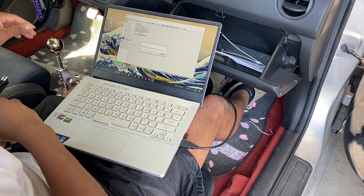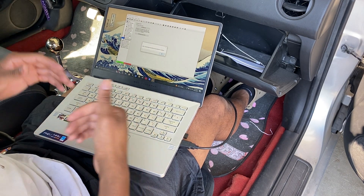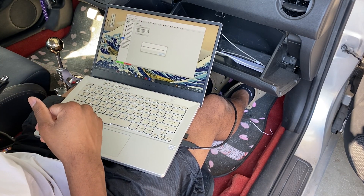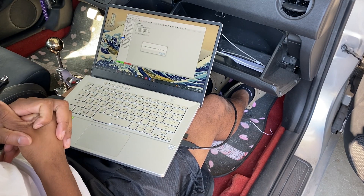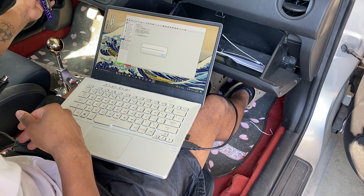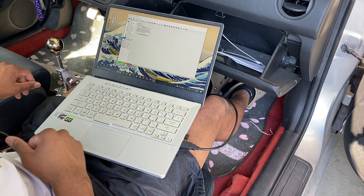The reflash has been done. Go ahead and key off and hit OK. After five seconds, key the vehicle on and hit OK to continue — give it more than five seconds. Usually wait for the beeps, then click OK.